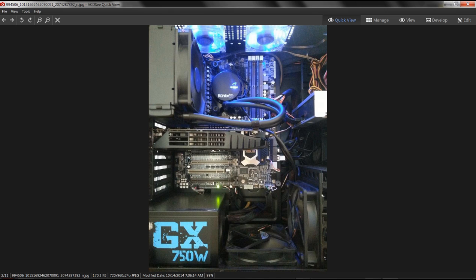This is the rig in the living room, using an Antec 920 liquid cooler with push-pull 120mm fans. You can change the color on this pump and the hoses look better too. Overall, the Antec 920 is way better than the Corsair H100 in terms of size. The only thing going for the Corsair is a larger rad for a bit more cooling. But the temperatures I'm seeing off the living room rig are actually competitive, even though it's only clocked at 4.6 GHz and I haven't tweaked it as much.